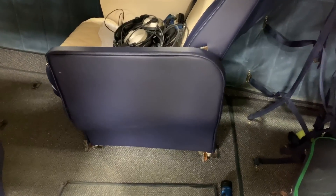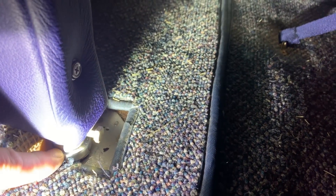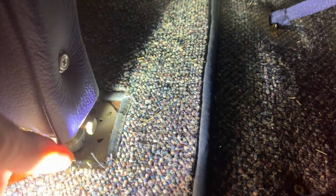The couch had a slightly different foot position for each of the legs — they're very close but a little off. If you notice here, the leg doesn't line up exactly with the hole in the floor. I looked at a number of different options and decided, in order to keep everything the way it is in the airplane without having to change anything, I would make new pieces for the chair and offset the little nipple piece that goes down into the floor by a quarter of an inch, so it'll fit into the floor without making any changes. That's what we're doing now — installing these new pieces.